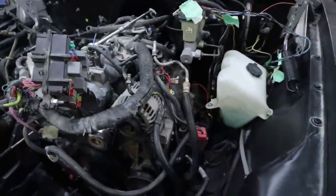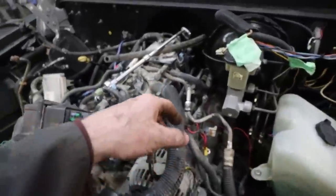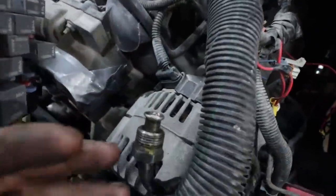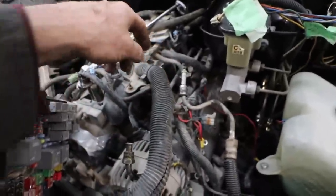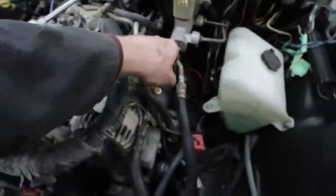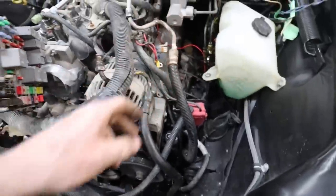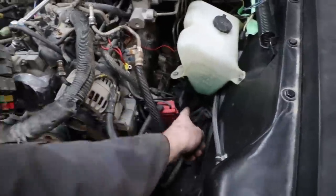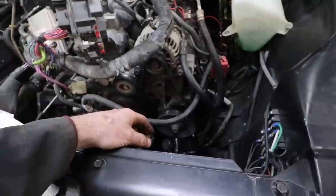So I'm quickly trying to do the power steering swap. And I guess being the older Camaro, like the newer GM boxes, I'm pretty sure this is how the fitting on the line is. And being a 60s front clip, it's actually just a double flared end. So what I'm going to do is basically just cut this off, steal this flare, stick it on this line, double flare it, and then I can smash it in and reuse the pressure line that came off the LS pump. And the other line, the non-pressure line, I'll probably just get a new piece of hose and loop it around onto this pump. Although this might just be long enough if I take it off that pump.